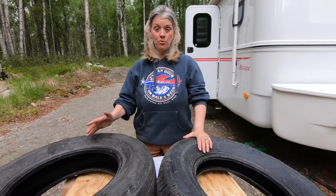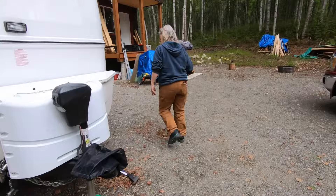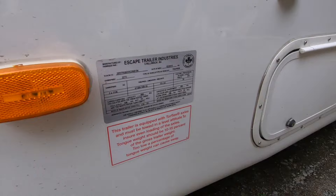If you're considering putting different tires on your RV or trailer, make sure you know what the Load Rating needs to be. Escape put Load D tires, which is actually great because for the weight of these you only need Load C. You do need to know what the weight of your trailer is — we've had ours weighed. If you don't, you can find the sticker on your trailer, which gives you the GVWR. To get the Load Rating, divide by two if you have a single axle, or by four for a double axle. Being full-timers and pretty close to max weight, we'll need tires that handle at least 1,250 pounds per tire, and you want a built-in safety margin of at least 20%. Load C tires do that, but Load D tires do it even better.